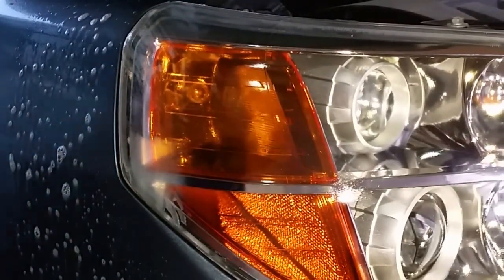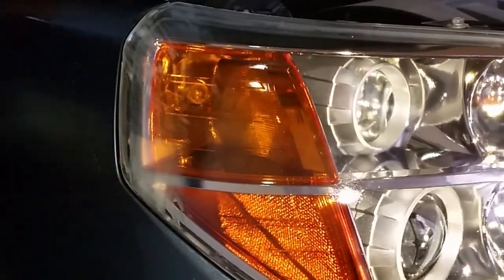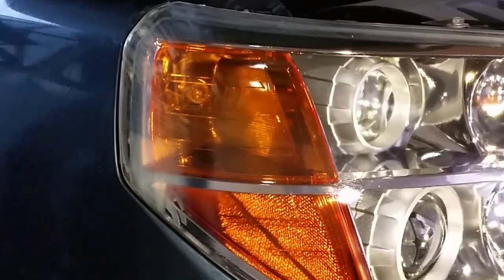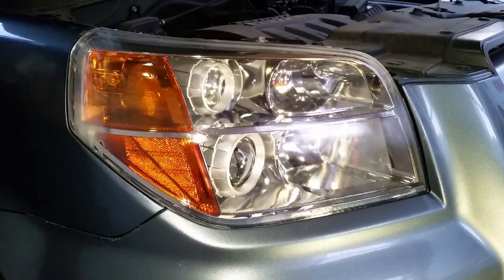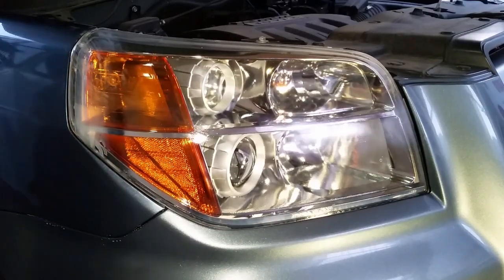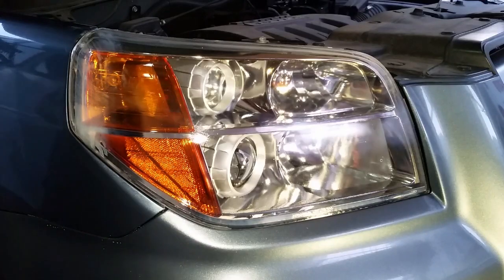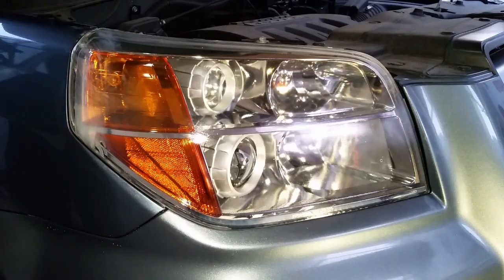Here I cleaned the surrounding paint with Windex right away to get the residue of the plastic and acetone off. Unfortunately I got some of the Windex on the still-drying lens and it was absorbed by the acetone, which then caused the plastic to haze over in that area. This isn't a disaster, it's just annoying. It can be corrected by waiting until the lens is completely dry, then doing a single swipe over the affected area with a towel saturated with acetone.